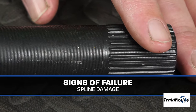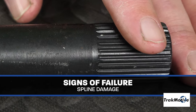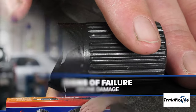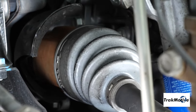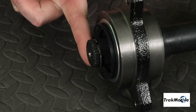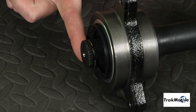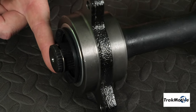The other consideration is the splines themselves. You have a spline that goes into the transmission and also a spline that goes into the other wheel. With 250 to 300 horsepower, that puts a lot of stress on the intermediate shaft, and over time the splines can be damaged if they're not properly installed. It's key when installing one of these shafts that you make sure the circlips are not reused — the shaft needs new circlips to hold it on either the transmission side or the axle side.